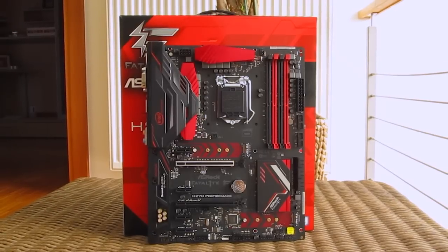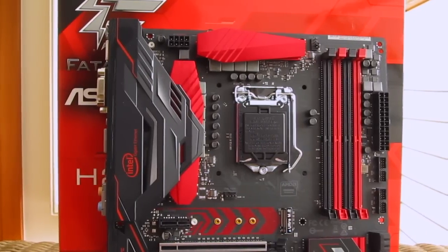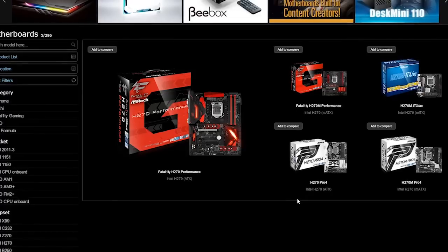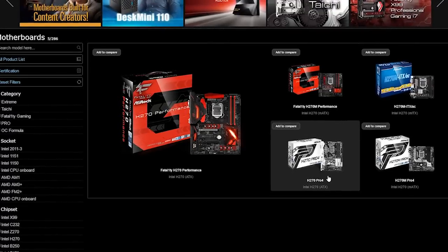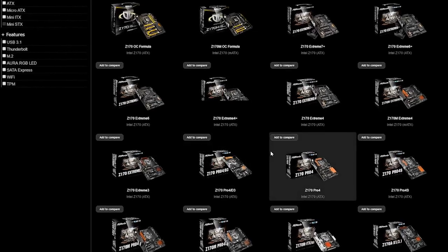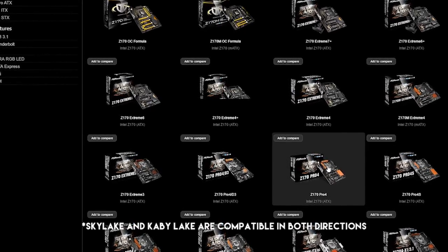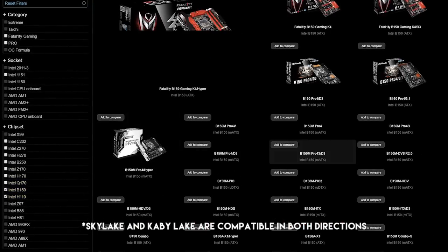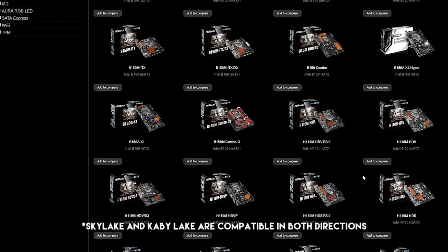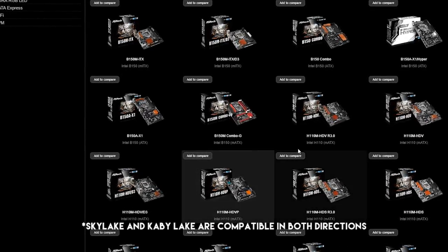At the end of the day, although this is a good-looking and seriously feature-packed model that will certainly have its customers, it's hard not to ask yourself whether the extra $20–$30 compared to other H270 motherboards is really worth it — especially knowing you cannot do any overclocking with it. For that amount you could get an entry-level Z170 or Z270 model that enables overclocking, while on the other hand, if you're not planning to overclock and don't need any special features, you can easily go for an H110 or B150 chipset-based motherboard with decent connectivity for much less.